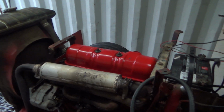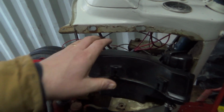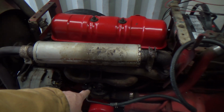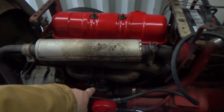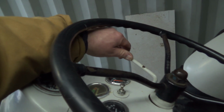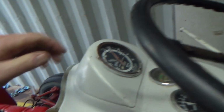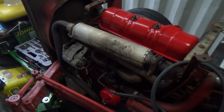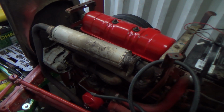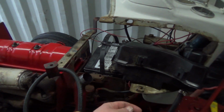Though it'd be nice to get that old oil and crap flushed out of there, but that's not lasting much long. But yeah, that needle there is, I think, the idle circuit, the air idle screw, and it's hardly open. Seems to be running pretty good there. Idle's right down. Seems to be happy there, so maybe I'll try it there for a while. But I guess when it's at idle, it doesn't really need a whole lot, you know, so that's good. I'm pretty happy with that.